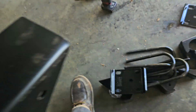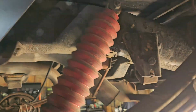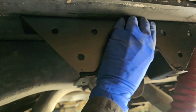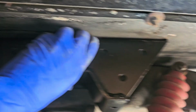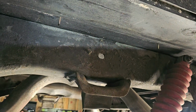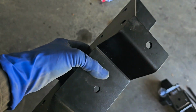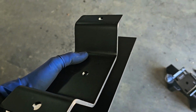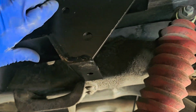All right, as shown before, this side goes towards the inner of the vehicle and this is towards the outer. I wanted to get you a better setup. Basically, this is going to be sliding in right there. The trick to this is, there's 8 bolts on this bed, and if you can get it up like an inch, you can weld it on top and sides. I like to weld in these holes as well because this is a permanent thing for this truck. You can always lift it, but what we're setting up will be good. Then you simply slide it on.